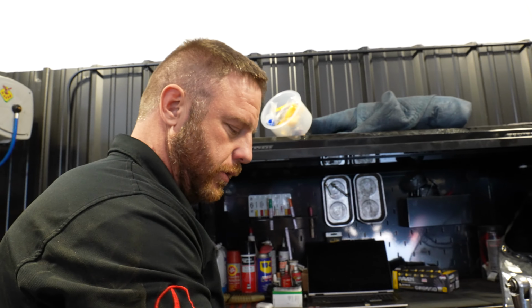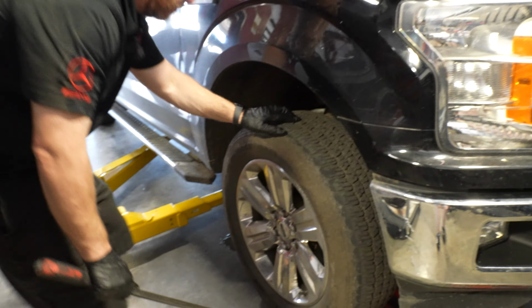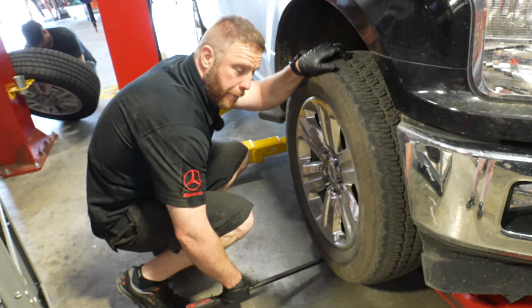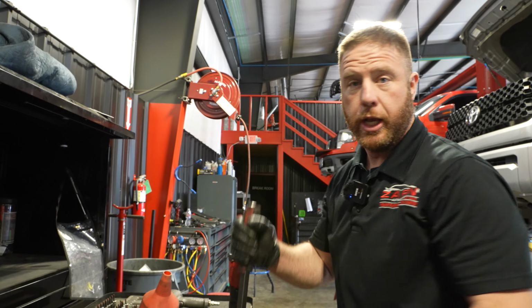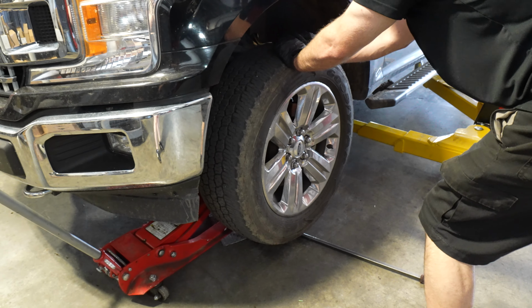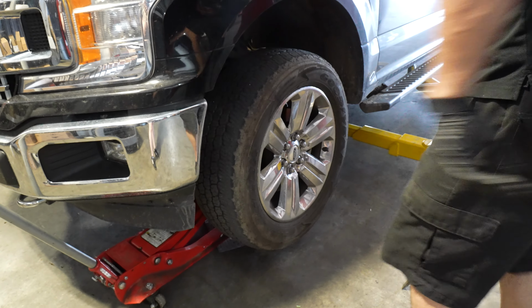She's nice and solid. A little bit of play is considered normal on some manufacturers, so keep that in mind. And if you have tapered bearings, obviously it's gonna move. That's normal too. Lower solid, I'm looking for anything popping. A little bit of popping's okay, just tells you to keep an eye on it, but a bunch of popping, not good. So that side's good. Solid. There's a slight, like very, very slight, so I'm okay with that.